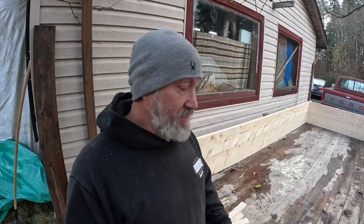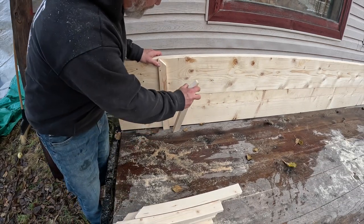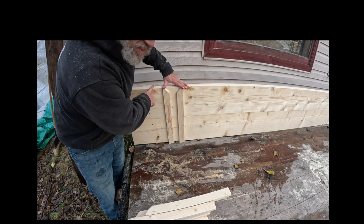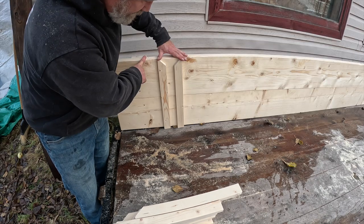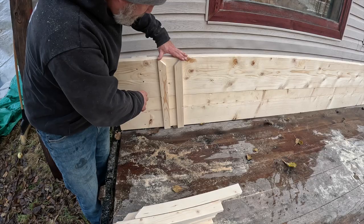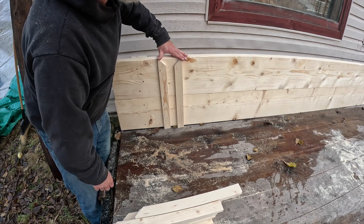I'm back at it. The weather is cooperating for a bit so I'm going to see what I can get done on the flat deck trailer. I've beveled the tops of these slot strips to allow the wall boards to slide in. There will be two strips, front and rear, about two inches apart — because the boards I'm using are actually one and three quarter inch thick. I've beveled the top so it'll slide in easier, and I'm going to have four of these along the walls matching both sides, just screwed to the 2x10s.